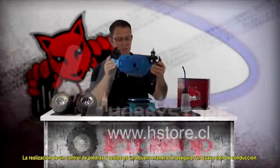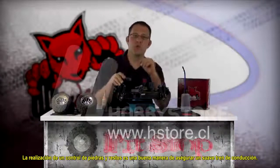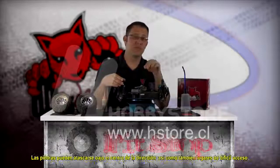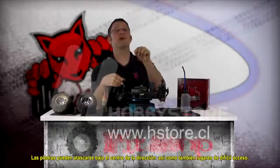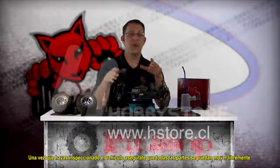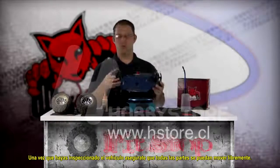Conducting a rock and debris check is a good way to ensure a smoothly running drivetrain. Rocks can lodge themselves under center drive shafts as well as other hard-to-reach places. Once you've looked over the vehicle, make sure all moving parts can move freely.